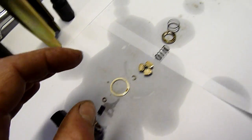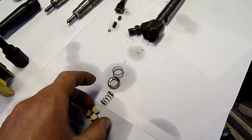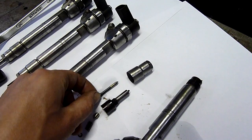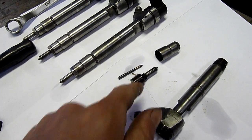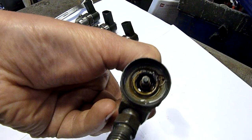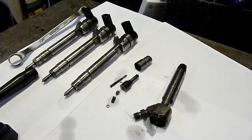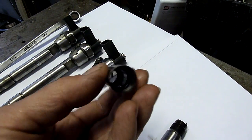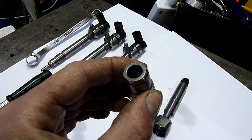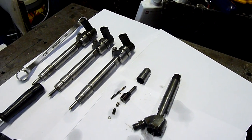It's a good source of parts anyway. The piezo should still work and be cleanable and serviceable. The body itself, maybe, maybe not. The internals can be replaced — plenty of service kits out there. I'd say it's had exhaust gases getting into the system itself because it comes all the way back up to the top, to the spill line. You see all that deposit in there? It comes all the way up into the cap and through the spill line. So I'd say this one has actually blown past the main end cap and it's been contaminating the system with exhaust gases. The cap itself is very pitted too, so it's suffered from the black death for a very long time. That cylinder is probably dead — that's probably why that engine got junked.